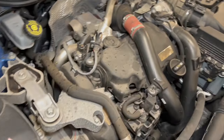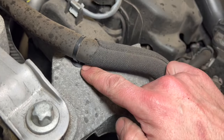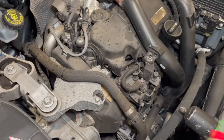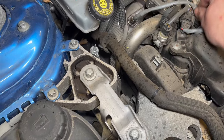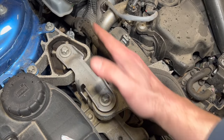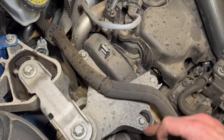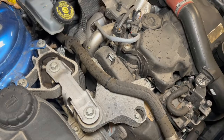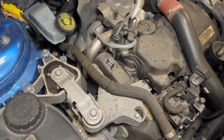With the engine cover and aircon pipe out of the way, next we remove the coolant hose across the top — it's held on with cable tie clips, just pop them out. Then we remove this cable from the casing. After that, we remove the top engine stabilizer mount — it basically stops the engine from rocking. It has E-torx bolts, and you'll need an E12 socket to remove them.